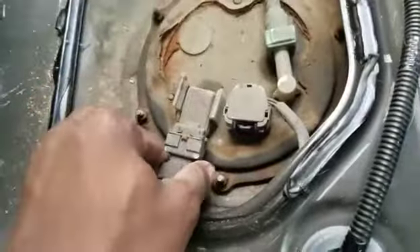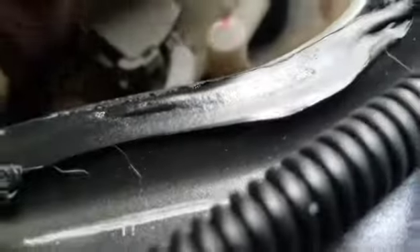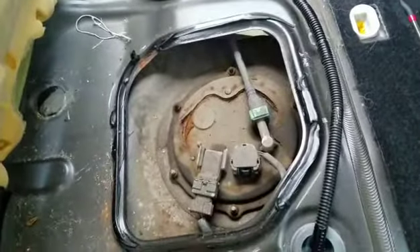We have a clip and a fuel feed. For the fuel feed, take a screwdriver, lift up this green one and pull it off. This one's a clip so find a way to clip it up. The other one has one of these rings — you just pull it over this notch right here and then pull it straight off. Disconnect all three of those.